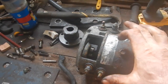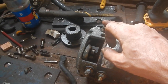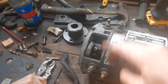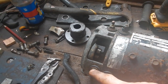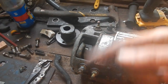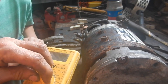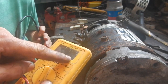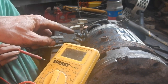If we check the resistance across here, electricity should be able to flow pretty easily. Electricity should be able to flow easily — this is just connected to the electromagnet on the back. This one goes through the brushes; it's the turning electromagnet. So if we check across here and across here, they should both have very low resistance. We can use our little tester for this. Let's check the resistance. Right now it's giving like a one and not really any numbers, because it's sort of an error — the resistance is higher than it's measuring right now. So connect one here and one there and the resistance should go way down.